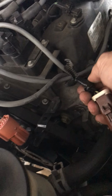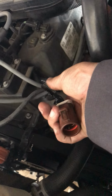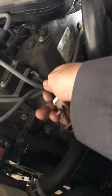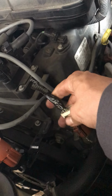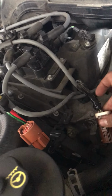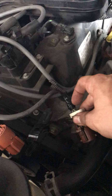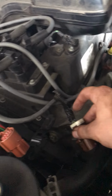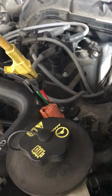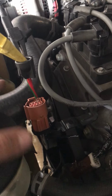The previous repairs were taped. Each wire was taped individually. But they weren't, after that, taped all together, snug together, so that would prevent the electrical tape, after it heats up, from sliding off of it. Because I noticed that all the tape was already kind of melting off, and it was sliding off, exposing the copper wires on one end, and it looked like they were touching. So after I saw that, I started suspecting that maybe something touched and shorted out one of the electric fan clutch circuits. So I'm going to show you something real quickly.